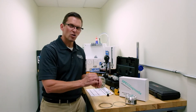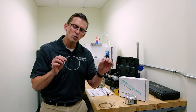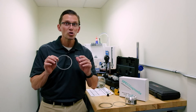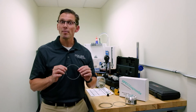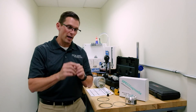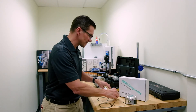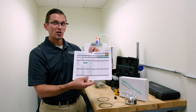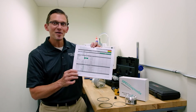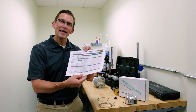Between the drain plug and your oil analysis report, that gives you the complete health check of your engine. If your piston rings are doing their job, you'll see the viscosity looking better, less wear metal, less fuel dilution — especially if you have a problem with your injectors that are damaging the piston rings by washing the oil off. You'll see the wear debris on the magnetic drain plug, and then you'll see fuel dilution and chromium and nickel show up on the used oil analysis report.